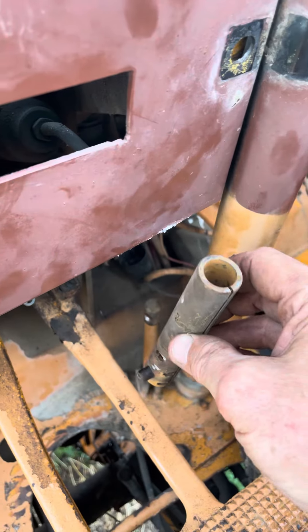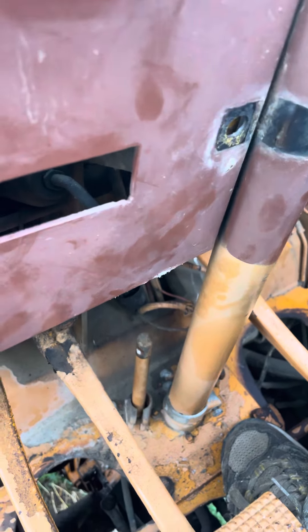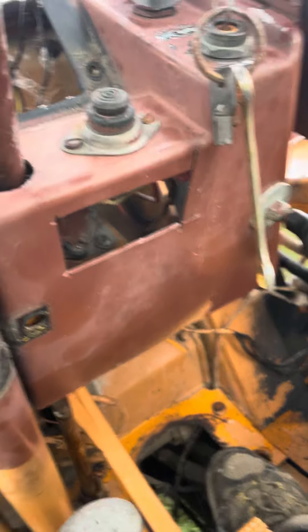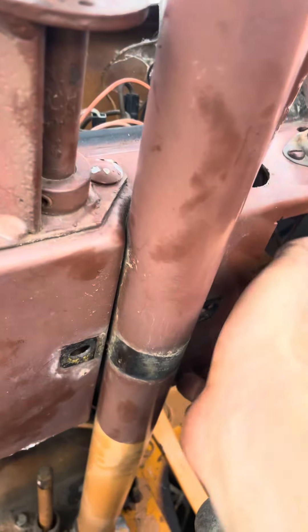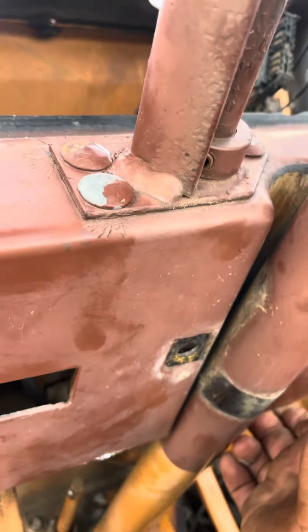Then you've got to slide this all the way off. But once you slide it off, this thing is the thing that's in the way of letting the dashboard come up. Don't bother taking this one off — I took this one off, but you don't need to. Just leave that one there for the throttle. And then the whole dashboard will actually lift all the way up.